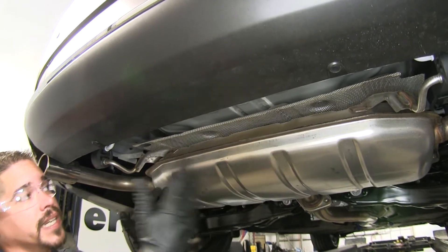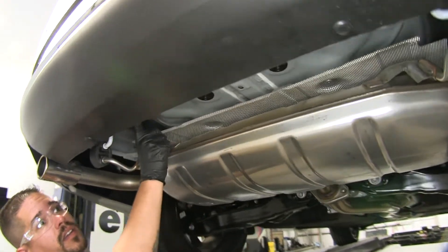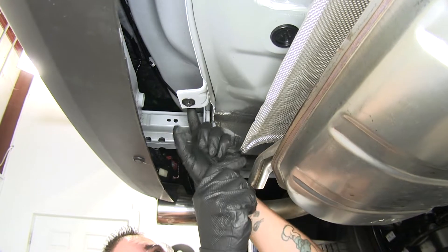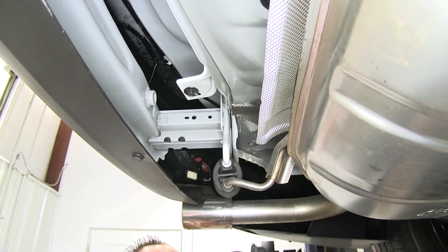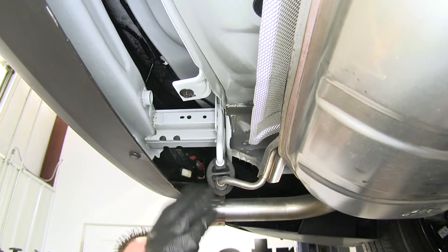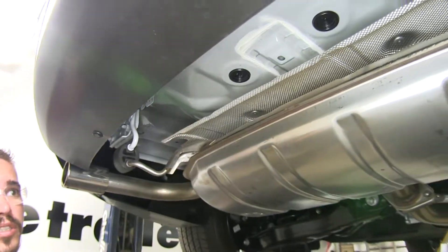Normally, there's going to be a plastic appearance panel tucked behind and up underneath this section. If yours is there, you would remove these two push pins, and then on each side you're going to have a 10 millimeter bolt that you'll have to pull out. You would reach up, push on the tab, and the whole panel would come down. I do recommend replacing the push pins in case you want to put that panel back up if you ever take the hitch off. Once you have it removed, you're going to leave it off because we're not going to be reinstalling it.